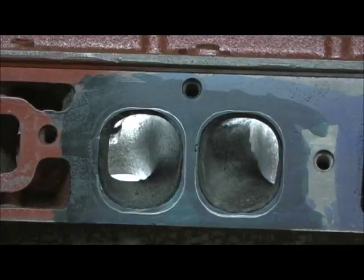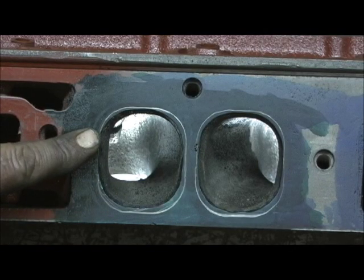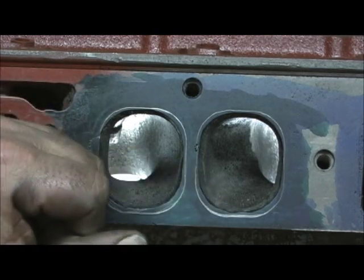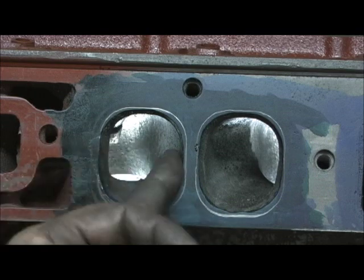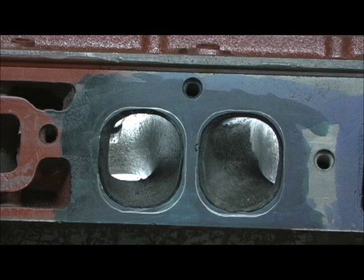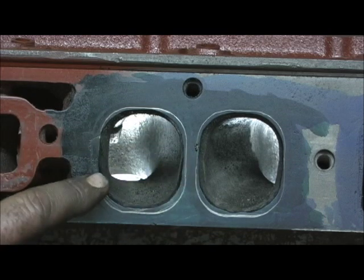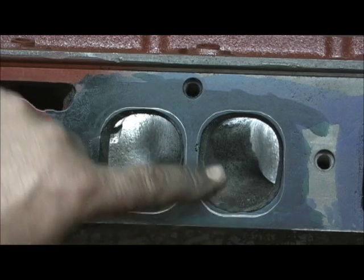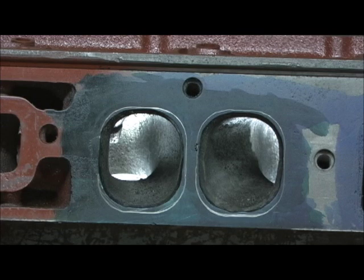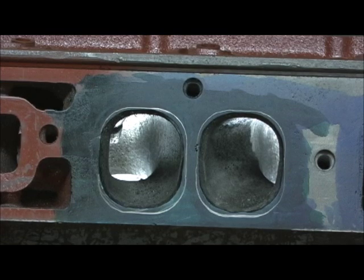Now let's look at the other side — same position. This tells me, when I look at this stuff, it was probably a left-handed cylinder head porter because they tend to put more pressure on this side. A right-handed cylinder head porter tends to put more pressure over here. So the person that probably done this was left-handed — it's a little game of mine, trying to put the mystery together. You can see the line, then pow, the break right there. This one pretty much got it all the way around. No problems — it will all balance out and come out fine.